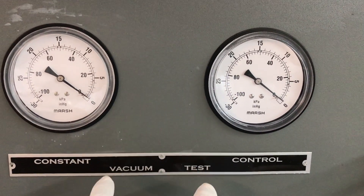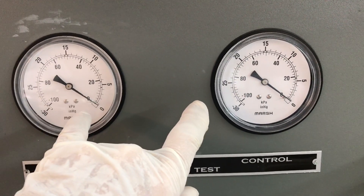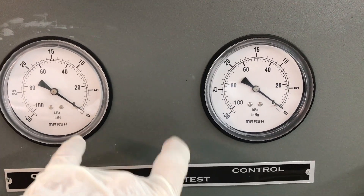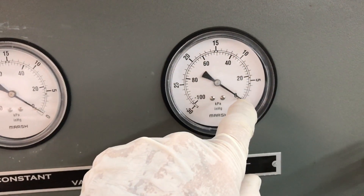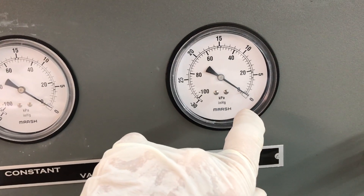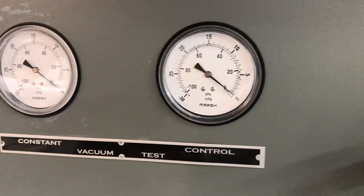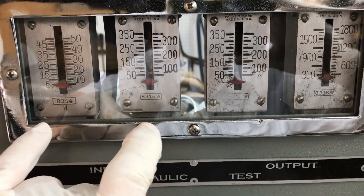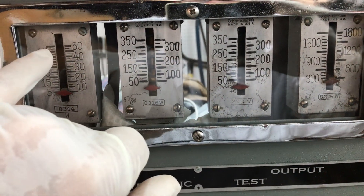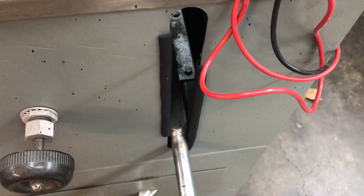What we've got here is our vacuum — both gauges are going to go up and read the vacuum as supplied by my vacuum pump. As the booster is activated, this gauge is going to slowly go down to zero until it is fully activated. Over here we've got our hydraulic input — both gauges are tied together; this gauge goes up, maxes out, and then this gauge reads final input pressure.